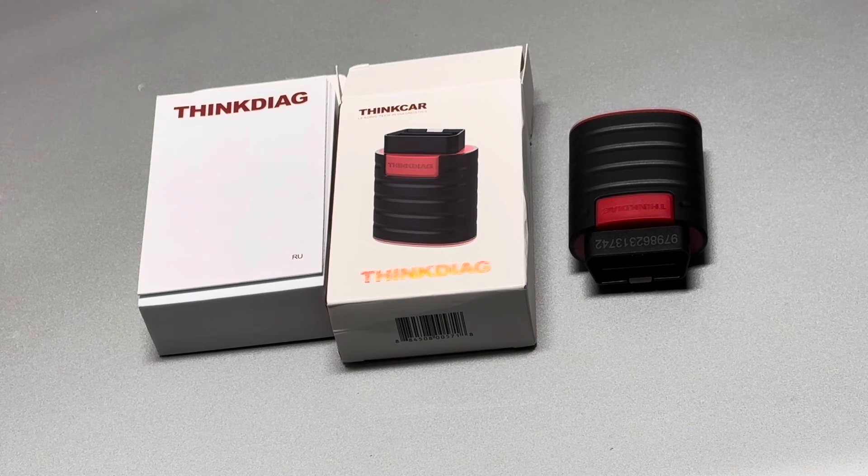This could also be great if you're looking at purchasing a vehicle. For example, on this particular car the check engine light doesn't actually work, but plugging this in would reveal the codes so you're not fooled before buying. Or you could see that emission monitors haven't been completed, indicating somebody had just cleared all the codes and the vehicle hasn't been driven far enough to see if they come back.